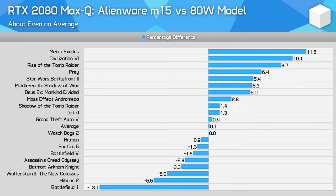For the rest of this data, I'm showing how the Alienware M15 performs without the base raised, because I feel this is how most people will use the laptop. The good news is that when sitting on your desk normally, the M15 performs around the same as the RTX 2080 Max-Q 80-watt variant — it's not throttling so hard that you aren't getting a decent level of performance. And by Alienware choosing the 90-watt model, you can actually achieve better performance if you give the cooler better airflow, since laptops with the 80-watt model can't push much faster even in optimal cooling positions.